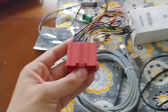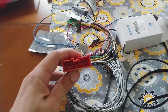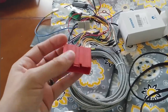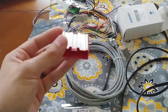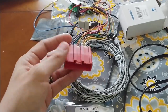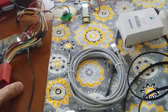Here we have a wiring harness. This wiring harness plugs directly into the stock wiring harness in my car, so I won't have to cut any wires. I bought this on Crutchfield - you can get it online for relatively cheap, I think it was like 20 bucks. This is pretty essential because you don't want to cut your stock wiring. You plug this in, then you can take what you need without disturbing the stock wiring.